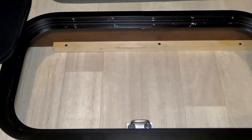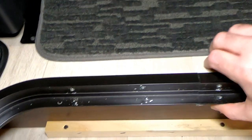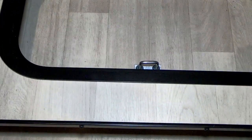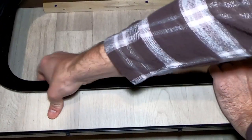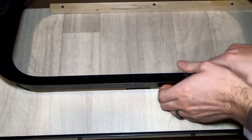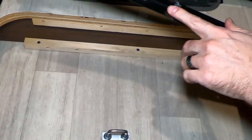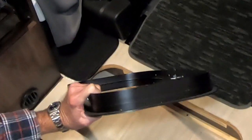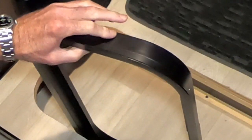Another important fact is that although this frame looks like it's one continuous piece, it's not. There is a gap back here in the part that's closest to the driver's. So when you take out the frame, you want to start at the part of the frame that is furthest from the driver compartment. So it pulls out quite like that, and that's what you get in the end. They've glued or taped it in, one or the other. Once the frame's out, we're going to turn it over and remove some of this metal that's on the side.